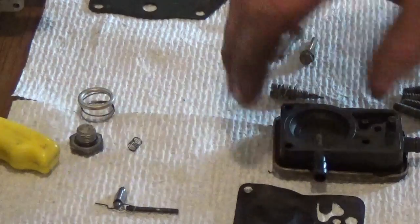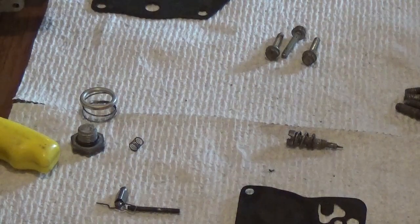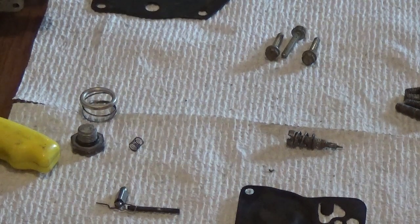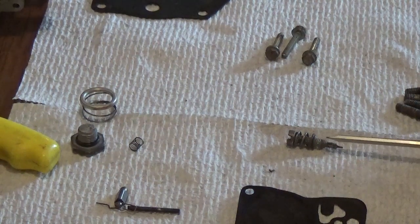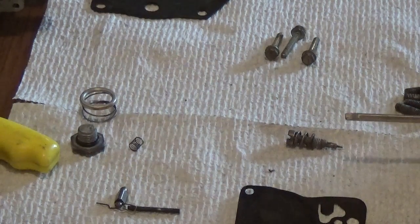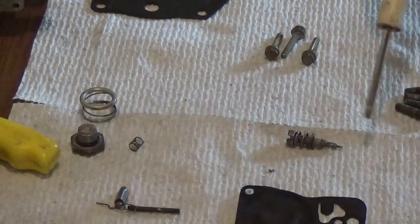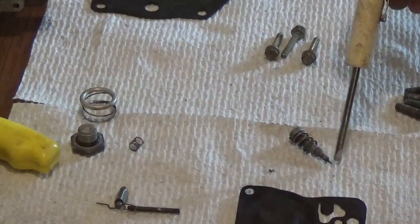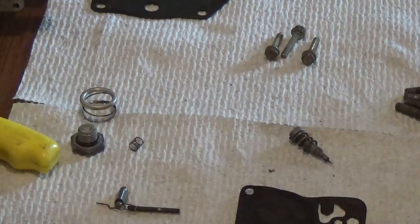This, if I've already failed to mention it, is actually your idle mixture valve. And if you start your motor up and it's surging really crazy, or just acting erratic, this is generally a good place to start. Ninety percent of the time, it's just some kind of little speck of dirt, or maybe a little bit of powder residue that will make its way onto the end of this little needle and cause you to have those symptoms. And it's a simple matter of just turning the screw left or right to basically get the engine to straighten out and run right.